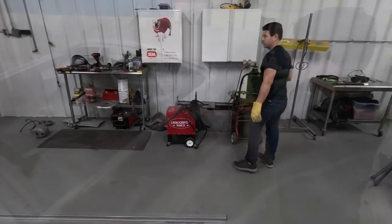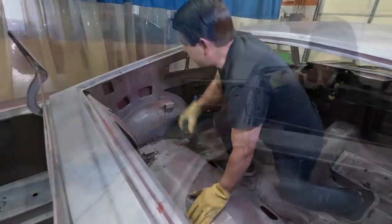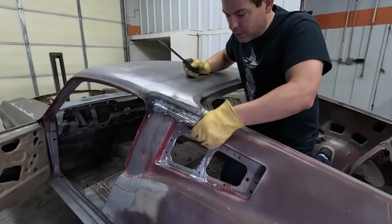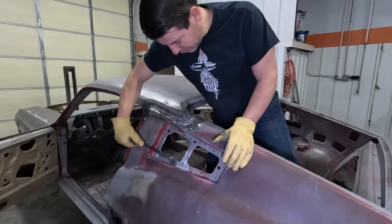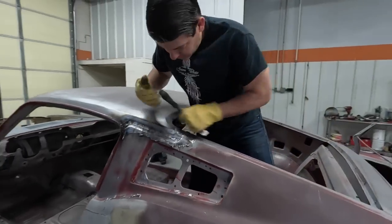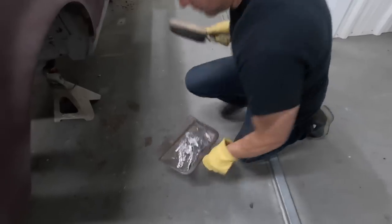Now you can sometimes shape the lead, grind it down, shape it to where it's actually flatter. I usually like to grind it down where it's slightly lower and then go back with body filler and shape it. Like on the Mustang, for instance, it has a lot of sharp little body lines that come across the roof, come around the window. And to mold that back in takes a lot of time when the lead, most of the time, is not even there. So I use the modern fillers to actually mold that in. So we got all the lead cleaned up and disposed of.